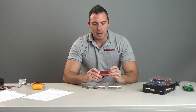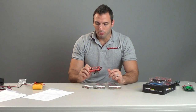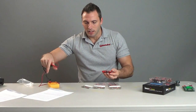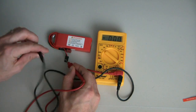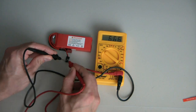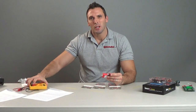To go ahead and show you this, this battery was just pulled off the charger right before I started talking. It hasn't had a whole lot of time to discharge at all. So let's go ahead and take a look at what the voltage reading is on this — you can see it's 6.66 volts exactly. If you tested this right off the charger, it would probably read like 6.8, but in the 5 minutes that I've been talking, this has dropped to its nominal voltage.